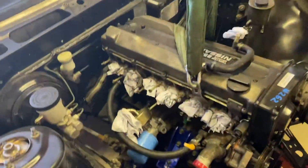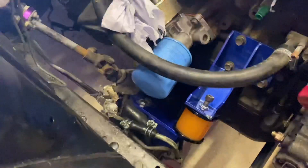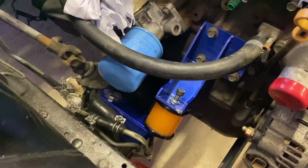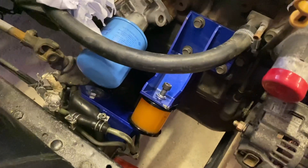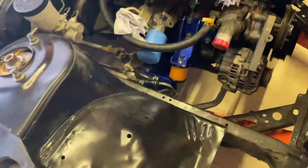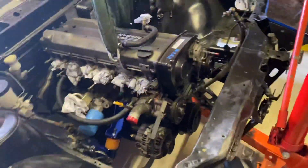We've got the engine hooked up to the engine crane. We've got poly bush mounts with the Hard Race engine mounts, so this is the stock S13 subframe. The engine has come forward a bit on poly bushing mounts, which keeps the engine quite nice and close to the firewall, but I don't know how much room we're going to have for the head drain kit — it'll be pretty close.